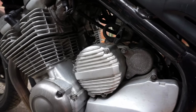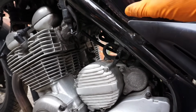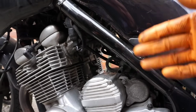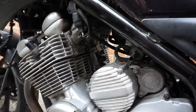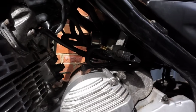The water in the top then. The water would sit under the petrol, wouldn't it? Yeah, water always sinks to the bottom, so in ideal circumstances it would be like a layer of water here, but because you got it out of the garage it might have mixed a bit. And obviously the carbs, they're always going to have water in them. Yeah, so I think we'll drain out the whole tank and then... Okay, so I've drained the tank